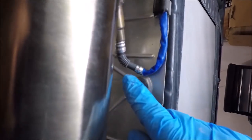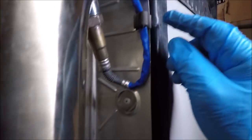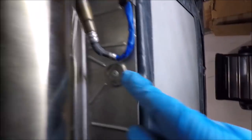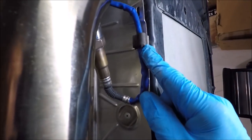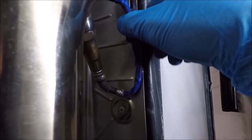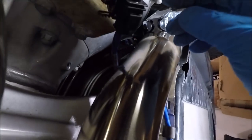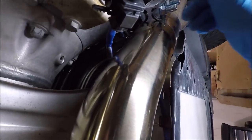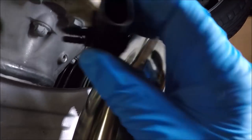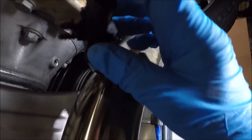The next thing I wanted to do was figure out where I was going to run my wiring up. I had the rear O2 sensors — they had these nice little clips that used to hold the wires on the backside of this heat shield. So what I did is I took one of those old clips from the rear O2 sensors and used it to clip my wideband harness on the inside of the wall here. I've just got the harness hanging here now, because I'm going to go up top and fish down the other side of this harness, plug it in, and try to pull it tight to avoid the exhaust, then probably go in and stick some zip ties wherever I can.